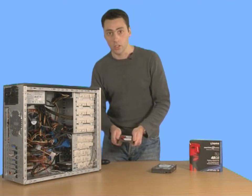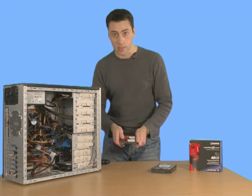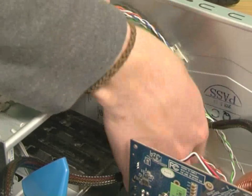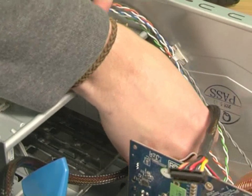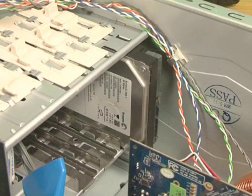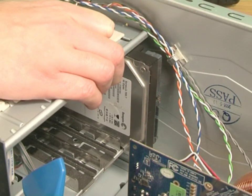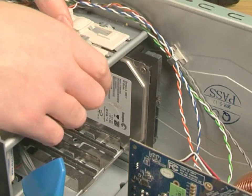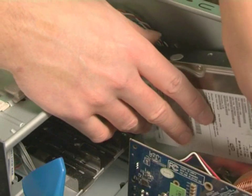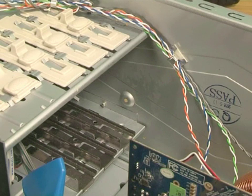Now if you're using this as a boot drive replacement, you'll want to take out your existing hard drive that will have your Windows partition on it and put this in instead. In this PC here we have the three and a half inch boot drive — we're just going to unplug the SATA power cable so we can take it out of the drive bay. On this case there aren't actually screws to hold the drive in; it's a plastic slot-loading device, so we just need to take that back, unlock, and it will just slide out.